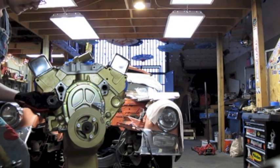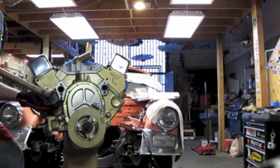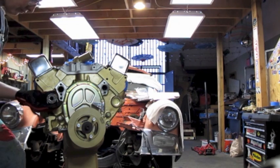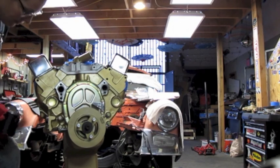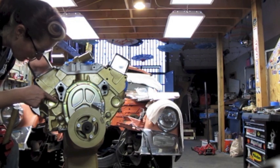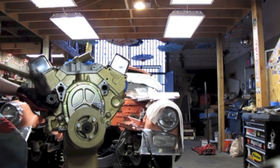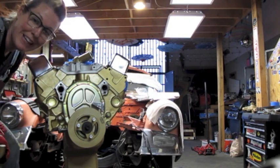So insert it. You want to make sure that it's sitting in there evenly and then give it a nice good whack. Make sure your fingers are out of the way. Keep an eye on it — mine has gone in kind of evenly. I'm going to keep whacking at it. You can feel to see if that lip is flush with the engine block yet. Mine feels good on one side but it's still a little bit up on the other side, so I'm going to give it a couple more whacks. And that looks good — freeze plug installed.